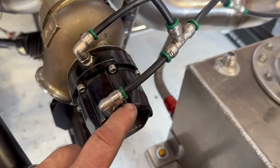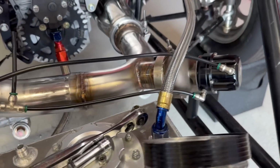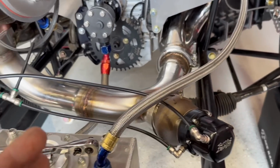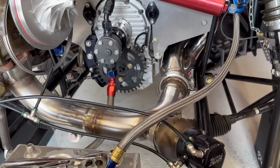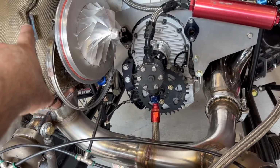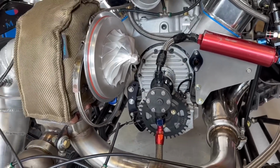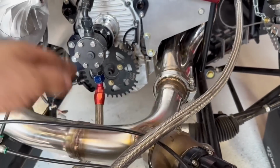So as you put pressure on top of this, it keeps the valve closed. Now, what's happening also that a lot of people don't think about is you've got back pressure. Back pressure in the engine, in the headers: the turbine wheel is spinning based on the exhaust coming out, and as this is spinning, it starts choking up the back. So ideally you would have 1-to-1. If you had 20 pounds of boost, you would have 20 pounds of back pressure in here.